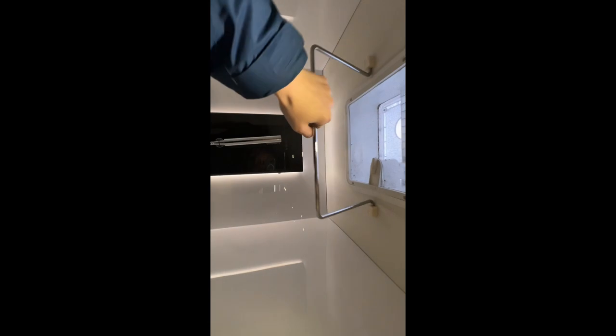Behind the large mirrors is a wardrobe with shelving. This is the infill cushion for the lounge, which I'll show you makes up the sofas and table into a bed — your second double bed. Ensure shower screens are tied back before travelling. When winterising, take off the shower head from the hose, unscrew it, and lay the hose in the tray with all mixer taps left open to ensure water drains from taps and pipelines. There's also a hanging rail for towels or wet coats, and you can open the skylight by winding it — but ensure all skylights and windows are closed before travelling.